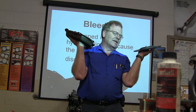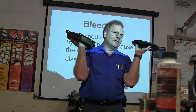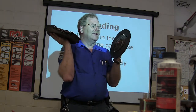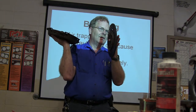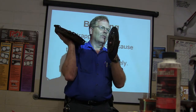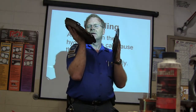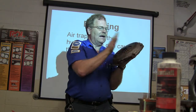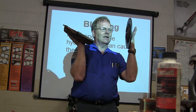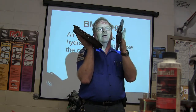You're supposed to replace these in pairs. If you go to the dealership sometimes they'll sell you just the disc — I've bought one for an Explorer — but it needs to spin true, because if it's spinning with runout it won't totally release since it'll always be touching. This bolts to the flywheel and the disc is trapped between them. When you mash the clutch, that diaphragm spring causes the heavy part of this to release it, and the input shaft of the transmission goes on the spline.